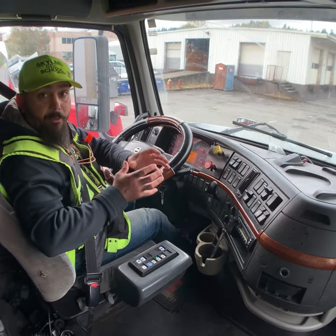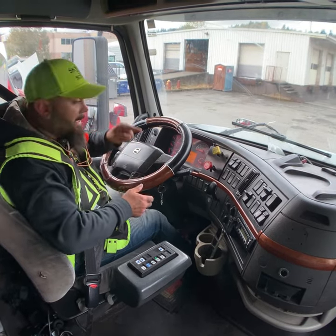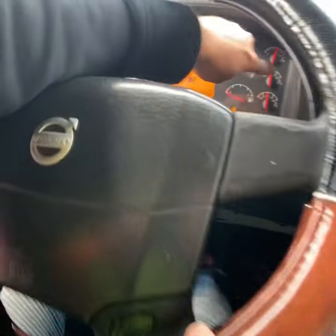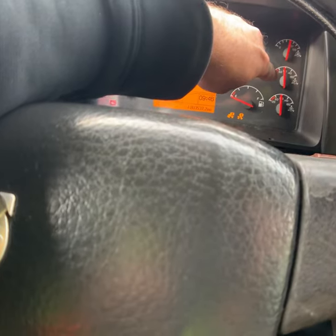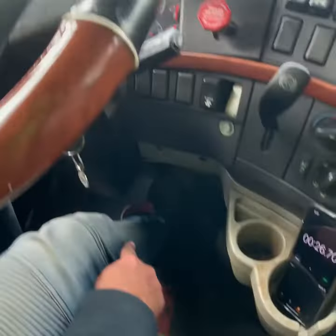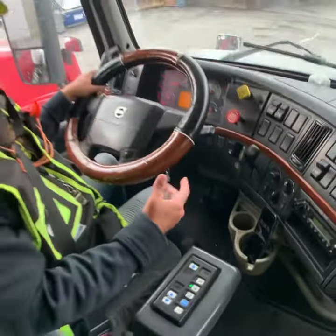Result. After 1 minute, the air pressure didn't drop more than 4 psi in 1 minute. The truck passed the test. Release your foot. First one finished.